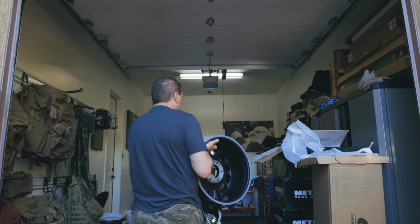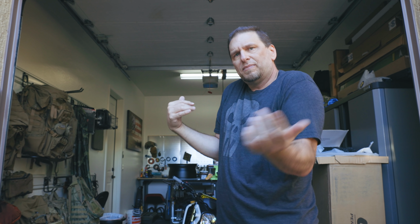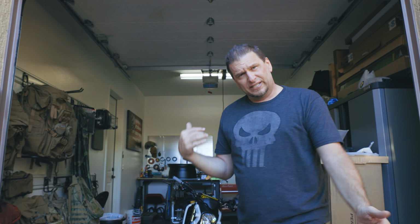I like these. Other than that, I'm going to swing the camera around, but I did one of those little tailgate assist drops. It's like the hydraulic things, like when you lift your hood or camper shell. When I added this plate to the tailgate, it made it a lot heavier and it really wants to slam down. I've always got kind of something in my hand when I'm trying to bring the tailgate down. This works really good, and it took about 5 minutes to put on.